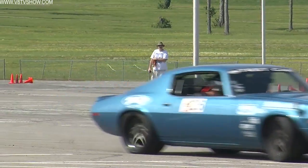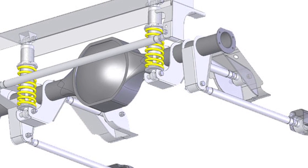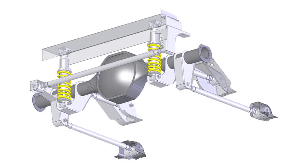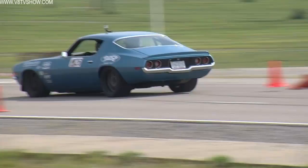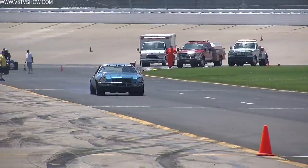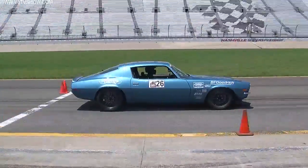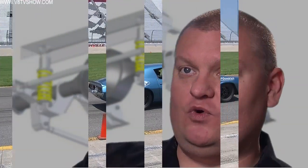When it comes to these types of rear suspensions, I actually like to think about them backwards. A lot of times you look at the hardware involved and you think that the leaf spring or the 4-link arms are there to hold the rear end in place as the car is driving. But it's actually the opposite. The rear axle and the tire are the only parts touching the roadway, and if you can imagine yourself pushing a cart around the shop, the rear axle and wheels would be similar to your body and your feet pushing forward, and the leaf springs and the control arms would be your arms pushing the weight of the car. So there's really a lot of force acting upon any type of rear control arm or leaf spring.